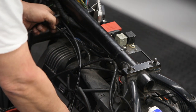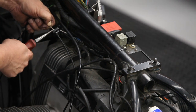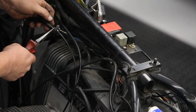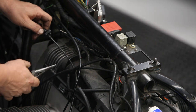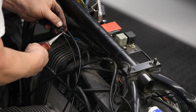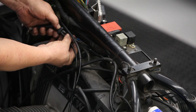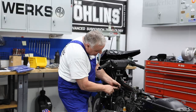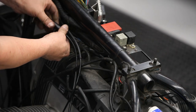And then, just like we took it apart, what we could do is push on the choke lever to expose some cable, grab that cable with a needle nose, get that inside like so, and that one's ready. And then the other one. Okay, so now we've got the two cables going in there. They're hooked into that little barrel. Center one's hooked into the other side. Now we can just screw it all back together.